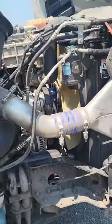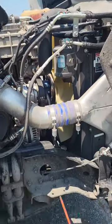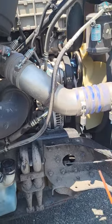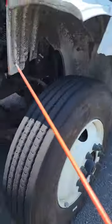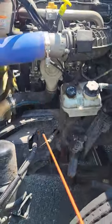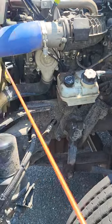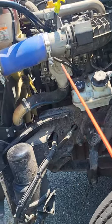I'm gonna catch all the hoses on this side — just do a circular motion — all my hoses are not cut, frayed, dry-rotted, or bulging, and I hear and see no leaks. We're all done on this side. Coming over to the other side of the engine, I'll continue with my hoses. Making a big circular motion — all my hoses are not cut, frayed, dry-rotted, or bulging, and I hear and see no leaks.